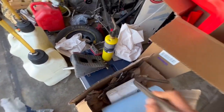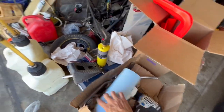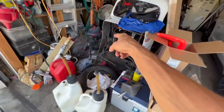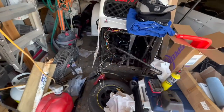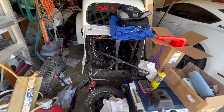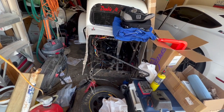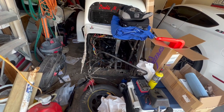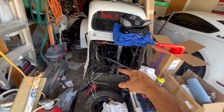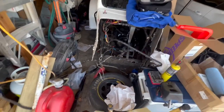You know, the cross member for your steering box and all the brackets for that's in. The lollipop there, it's in. I could not find that front firewall piece, so that's going to get straightened and welded back on. And then once we get all that stuff put back on tonight, then later on this week I'll start the frame rail.